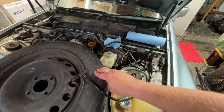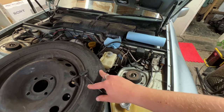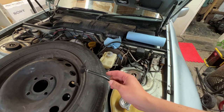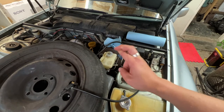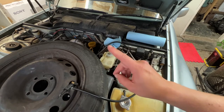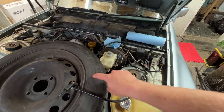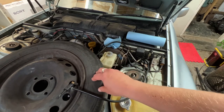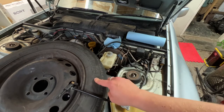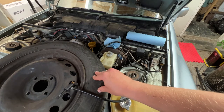So I've got an old tyre here, very well worn, that I've let down to 15 PSI so I can plug it into the system and should hopefully not run risk of blowing the top off. Now, luckily, it's never happened to me before, but I'm not one to take that risk. So this is a really great top tip. Find yourself a spare wheel that you can let the pressure down to what you need to and use that to run your system. It also means that your car won't have a flat tyre by the time you finish bleeding the brakes, which is quite useful.